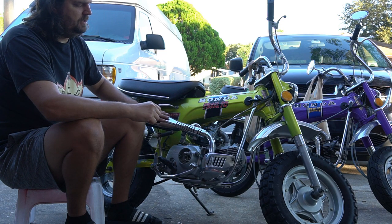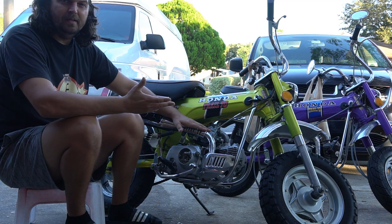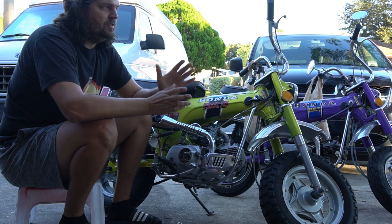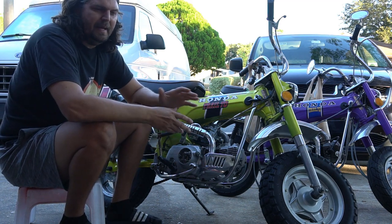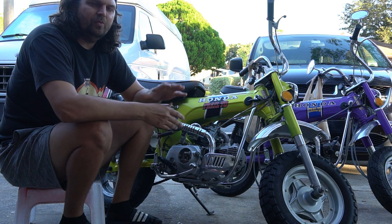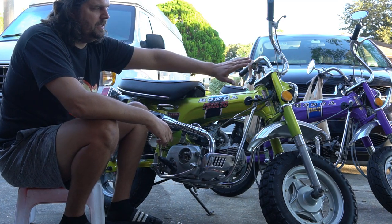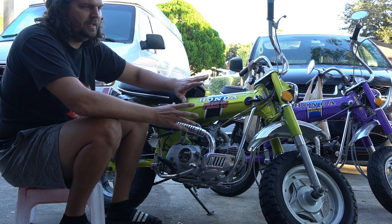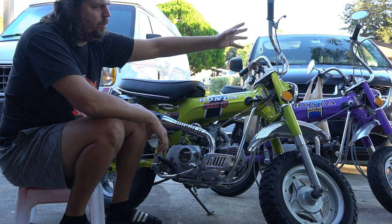This is an original pipe, but we're going to swap this one out for a Trail Buddy bigger bore pipe. It looks like the Chinese pipes, but apparently they have their own tooling and specifications that flow better — probably a bigger diameter pipe and freer flowing muffler area. So we'll get that pipe to go with the 125cc. We also need to swap the 6-volt acid-filled battery for a 12-volt battery and replace the bulbs with 12-volt bulbs.